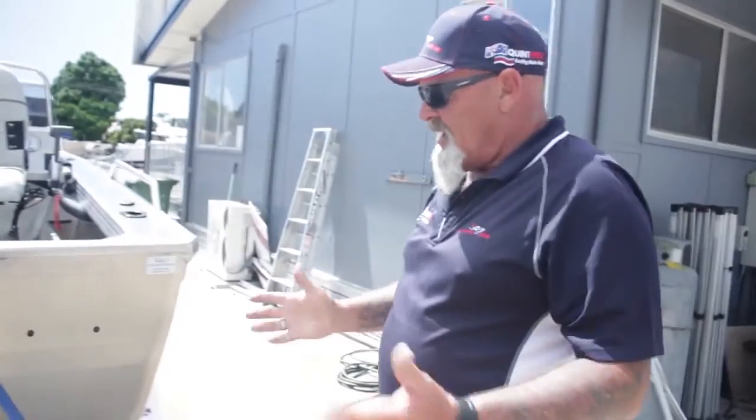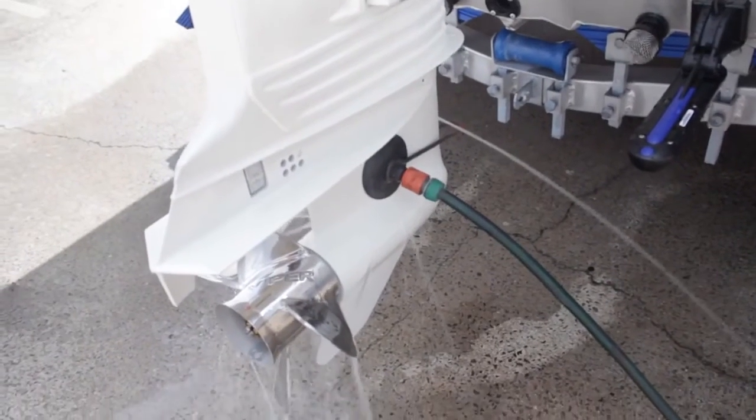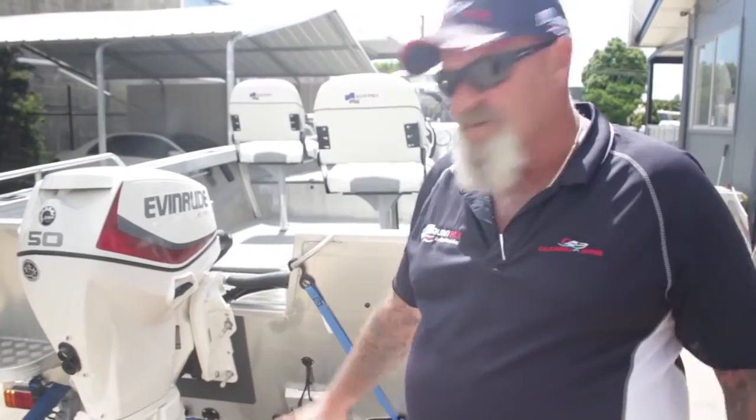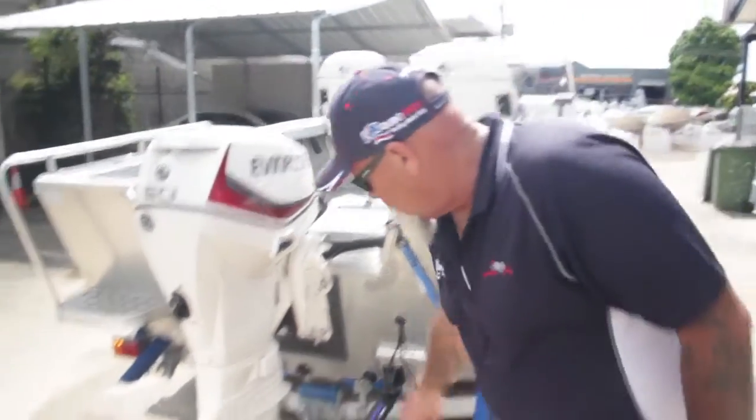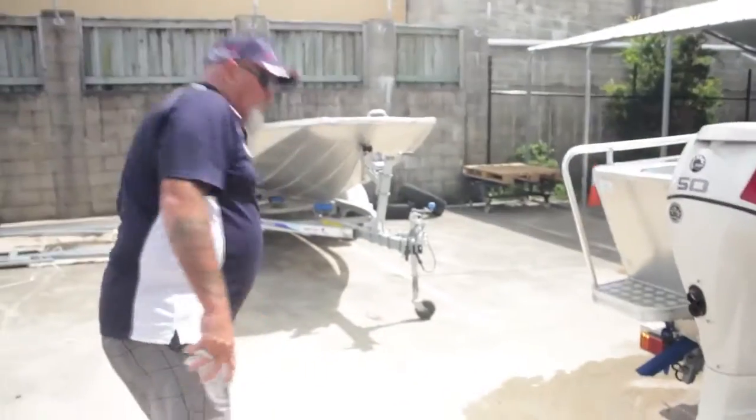Once that's done, I know water is precious, but let's go over and turn on some water. As you can see, I've got adequate pressure there — not too much. If you put too much pressure, you're going to blow the muffs off. You can see water freely running out of these holes in the side of the leg, so we know we've got them in the right spot.